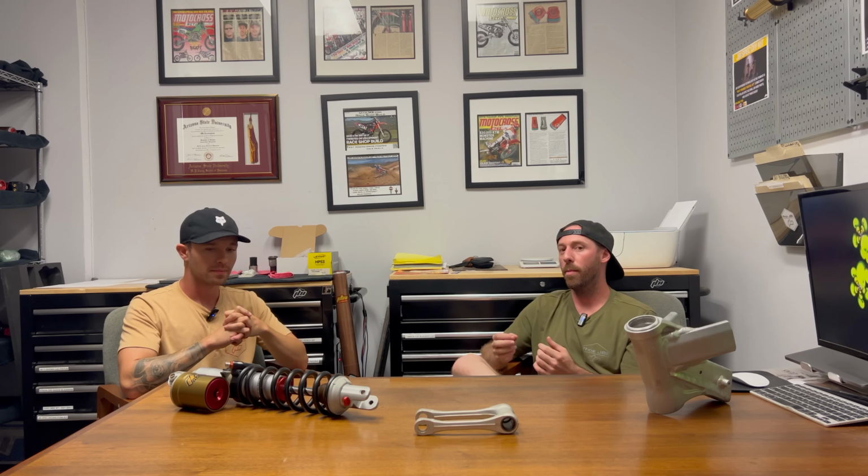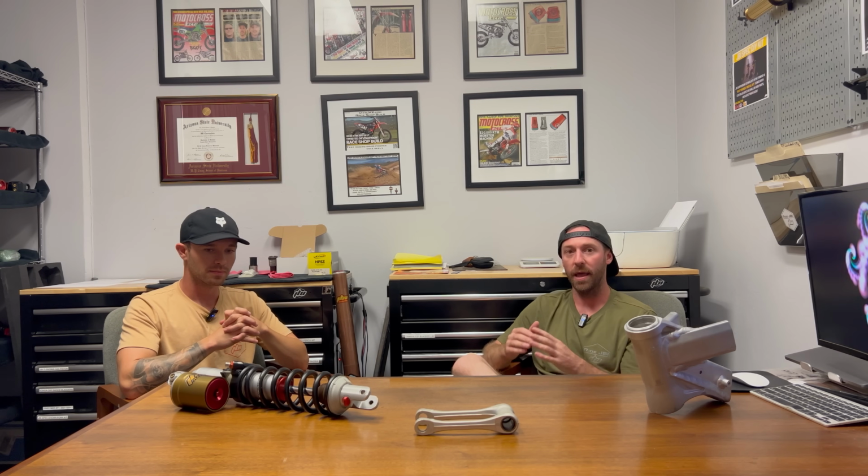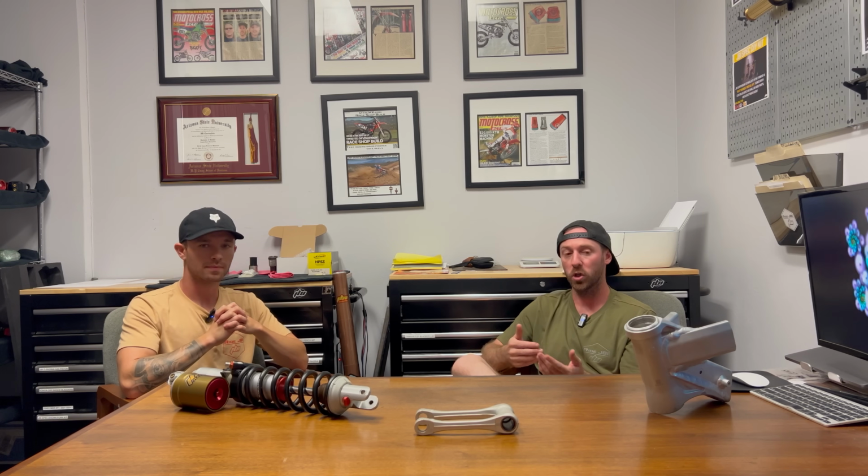But it's important to keep in mind that if that's best for that test rider, and you're maybe a different build, then you might find a sag number that's a little different than that, that's best for you. And I can understand the challenge of that part, because if you don't have somebody there next to you, maybe like me, a suspension guy, to give you the confidence of going, hey man, you're right, you do want to tweak this. I can understand the hesitation to adjust something based on what you read from a very good, trustworthy source. Again, an excellent place to start, but it's great to know how to further custom tune your bike to your specific needs.